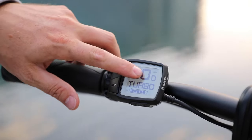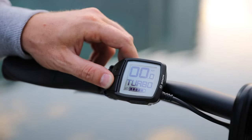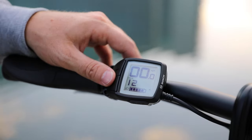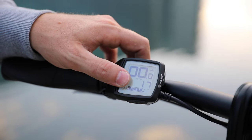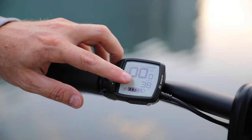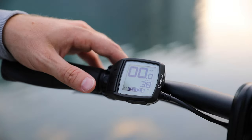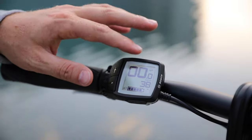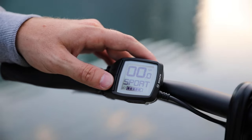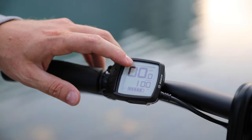On the screen you'll see your speedometer and battery life. If you hold the minus button down you can cycle through several different details — the trip odometer showing how long you've been riding, the total distance or odometer, and the range estimate based on your assistance level. Right now on turbo mode you have a 38-mile range. This bike currently has a 500-watt-hour battery but it comes standard with a 400-watt-hour, so in normal circumstances you'd see something like 30 to 32 miles on turbo. If you cycle down to eco mode that number jumps way up to 100 miles.